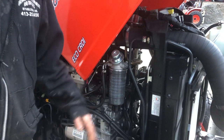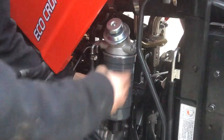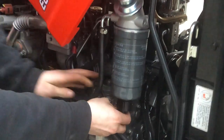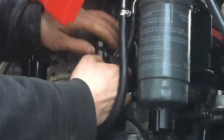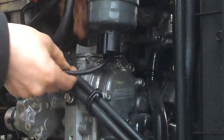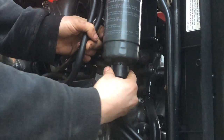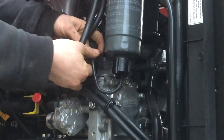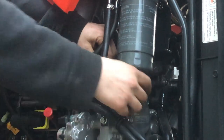Along with some of these fuel supplements, here's your fuel filter. If it did freeze up, you can use a propane torch to warm it up. If you've got to change your fuel filter because it's got some water in it or it's a couple years old, that's a good habit to get into. You're going to want to disconnect this electrical sensor right here, and then you can spin your filter off freely. With your new filter, spin this water drain off and install it onto your new filter. However, do not lose the O-ring, because you actually can't get that O-ring separately — you'd have to buy a whole sensor.